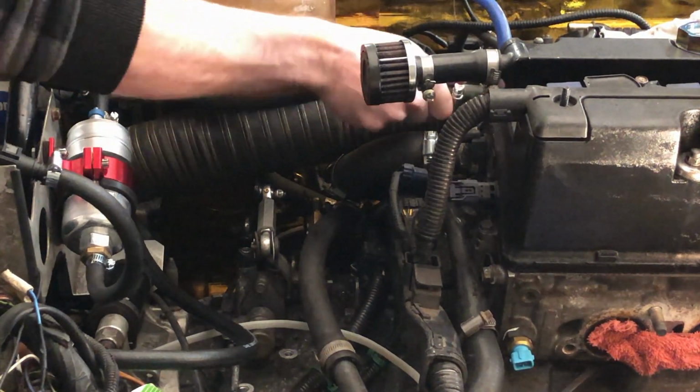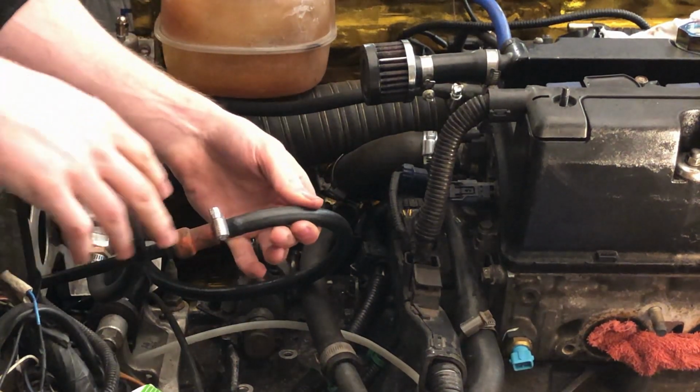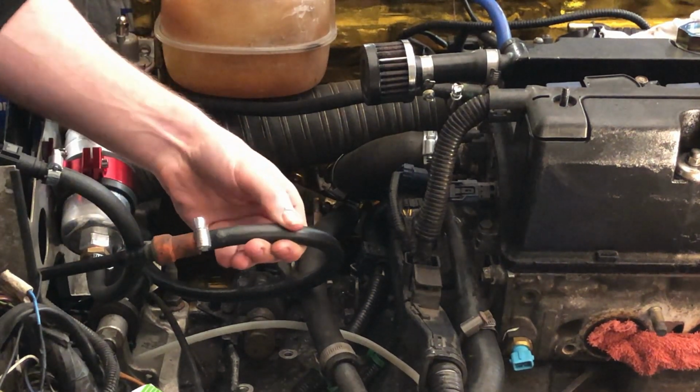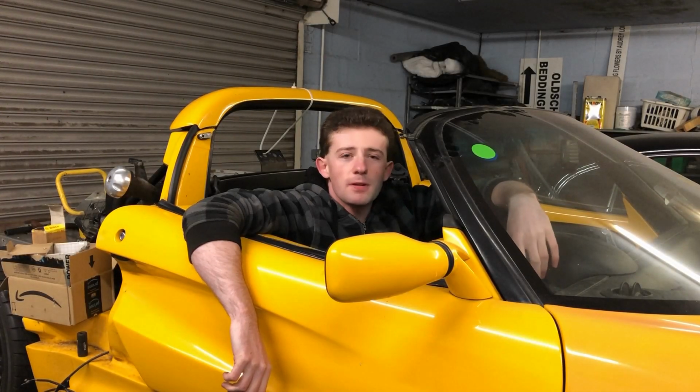So that's handy. Now any extra pressure comes round here to the regulator, where it's dumped out the bottom to this return line, which, handily, has a red quick release connector. Green for go, red for return, and then that just dumps back into the tank, and that's my full fuel system ready to go. So with our fuel and coolant lines plumbed in, it's about time to start this thing.